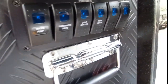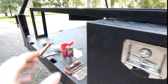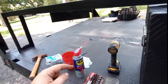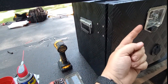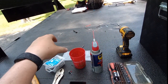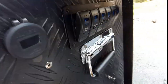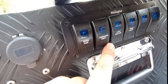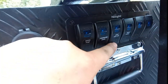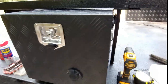I labeled all of these. This will be my 12-volt pump, which I've yet to place. I'm going to run the wiring from the pump under the truck and into there, and on this end there'll be a quick connect. So if my pump goes bad, I disconnect it, take the pump out, put the new one in, connect it, and never have to mess with the wiring — that was my whole plan. Then I have my underwater lights, which will be my tank lights. I'll have my light bar, which is this one right above me, and then my rear lights. And I have two open switches remaining.